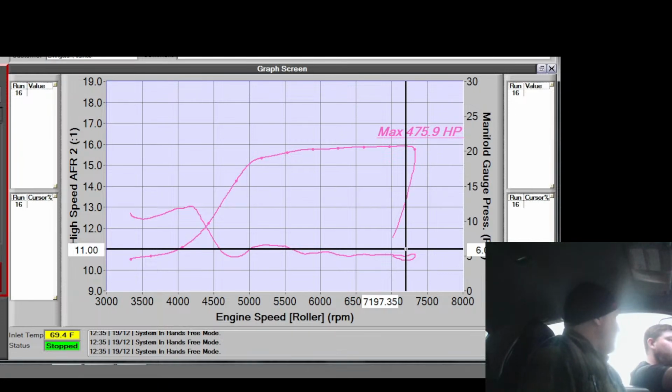If the belt's still on, my yellow gun will take them off most of the time. Yeah. But it has that quick impact thing. Yeah, I don't like these impacts too much because of the whole rattling, bouncing on the cams and the lobes and all of that. That's why I like to leave the timing belts on when I do it. Yeah, I leave the timing belt on it too for more support. Yeah. Provides a little extra resistance.